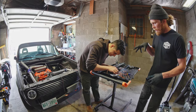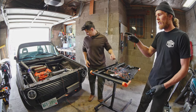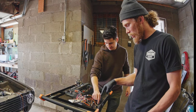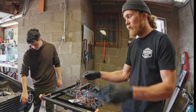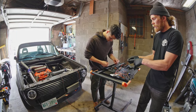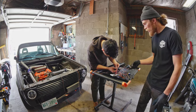Me and Dave — mainly Dave — has the code working on this Arduino such that we should be seeing appropriate movements out of our linear actuator on the turbo, which controls the vanes based on what pressure it sees. Our fail-safe test first: we have a potentiometer, which is just a fancy way to say variable resistance, hooked up that is simulating what the sensors are putting out. We're going to pretend this is our boost pressure and drive pressure, hook up the linear actuator, adjust the simulated pressure, and make sure the actuator is operating correctly with the car off before we hook it up to the real sensors.